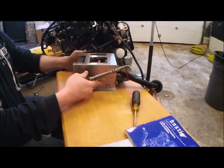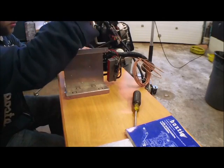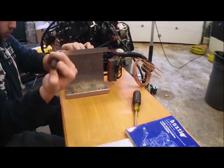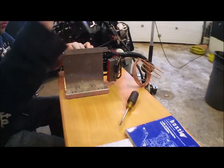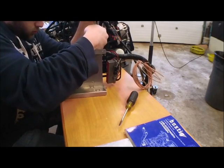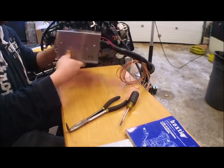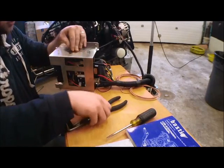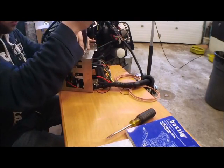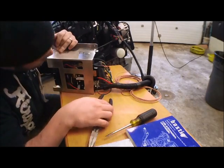The relays again are going to be pointed towards the back — try not to catch your fingers in it while you're doing it. Now you have the ECU cover in there and there are four small tabs protruding from the bracket. Take your pliers and bend them down and press them down so those four tabs are holding the ECU cover into the bracket. It's kind of like a car stereo where you bend down the little sheet metal tabs — same idea.